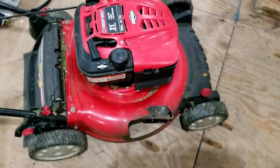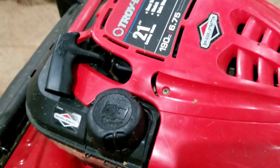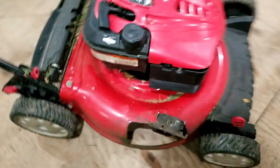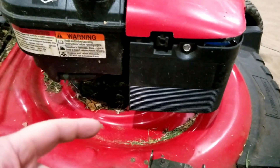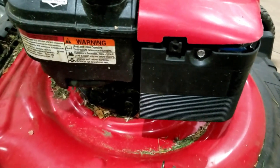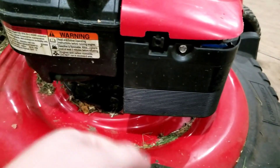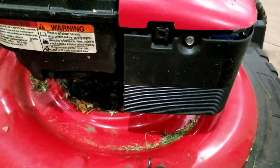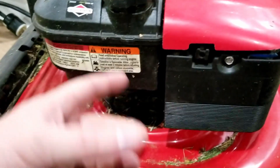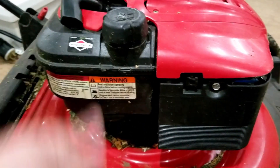That mower ran for about an hour and a half — that's a good running mower. Very nice. Another pretty simple fix. Mungo likes when it's not too complicated — better example for you folk at home. So you see, most times it's a fairly easy fix: take the little carburetor bowl out, clean out the little valves and jets. All good. Run out the bad gas — or you could drain it, but Mungo likes to run it out and use it so you don't waste any fuel, might as well burn it.